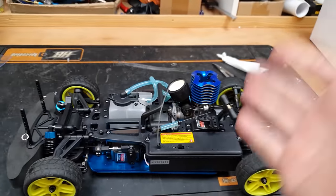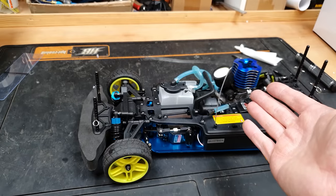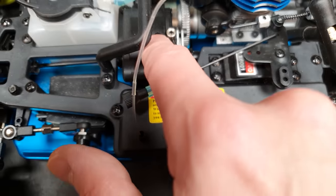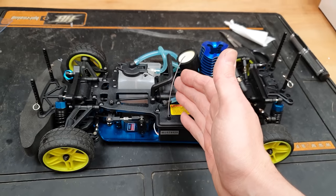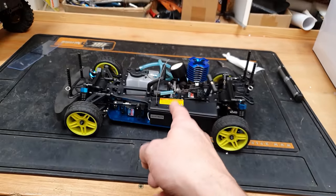I've not had to tune it, it's just running absolutely bog standard. And it hasn't hit second gear yet, but as the engine beds itself in, it's going to go a bit faster, and when it really does hit second gear, then it's really going to fly. I mean, there's a hole up here where I presume you can adjust the transmission shift point. So once it's all properly run in, we can get this thing going faster. If it doesn't change, we'll play with this and we'll get the second gear to come in. And I really think this is going to fly in second gear.